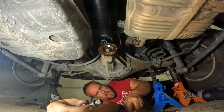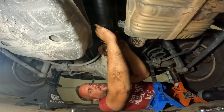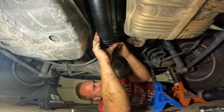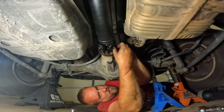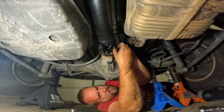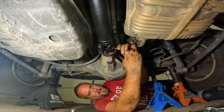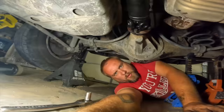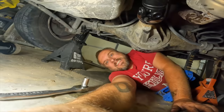I put the transmission in neutral again so I can rotate the shaft to line up the bolt holes. An ideal tool would be a couple of alignment punches to jab through, but let's just get it done. I got all four bolts run down finger tight, then put the transmission back in park so I can tighten them without the shaft turning. Before I do anything, let me know if I've messed up — I wish these were live streams.